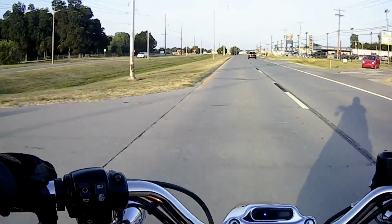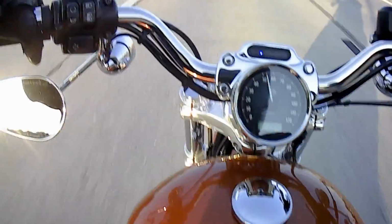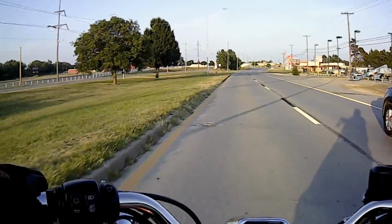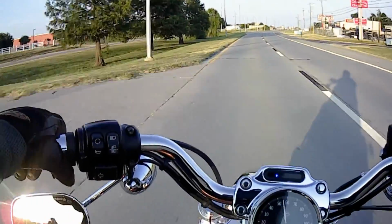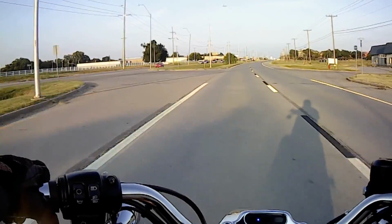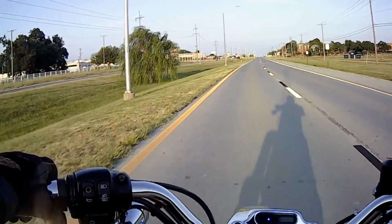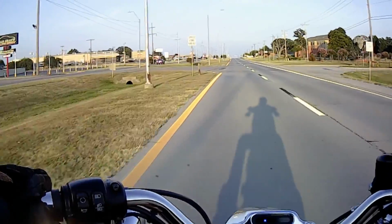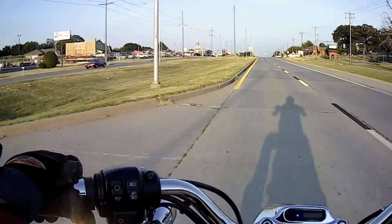Because I believe this kit, they advertise, if you're running the Screaming Eagle mufflers, it's roughly 85 horsepower with the full Stage 4. And then what they call race use exhaust, which is any aftermarket free-flowing 2-into-1 or some good slip-ons, you're looking at about 95 horsepower. But I honestly believe if you just put in the high compression pistons and the camshaft, choose your own air cleaner, your own tuner, and a good free-flowing exhaust, you get right in the range of this kit for a whole lot less money. The money you would save, you could definitely put toward your dealer labor.